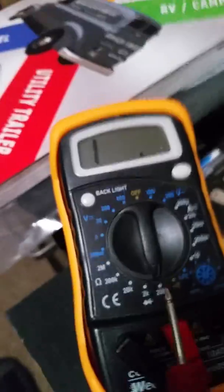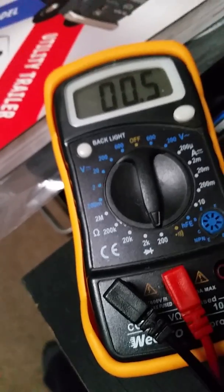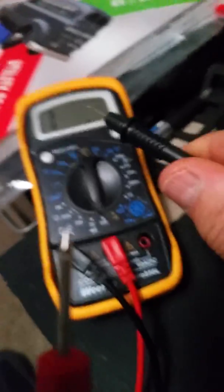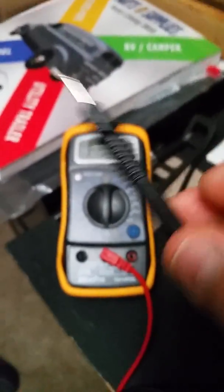Back to the 200 scale — we've got about 0.6 ohms on these leads. Now I'm going to show you something else. Let's say you touched them together and you got an open reading. How do you know what lead was bad? What you would do is take the black lead out, keep your red multimeter lead in, and test. Notice now how it says 0.4 — that would prove to you that your black lead was bad.